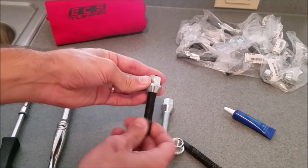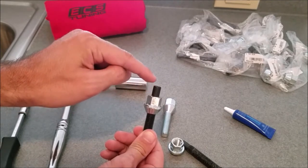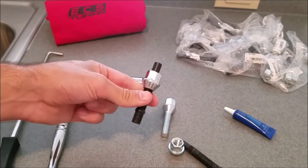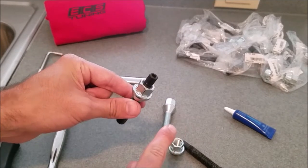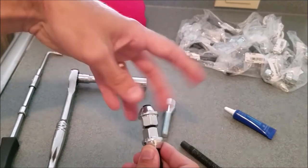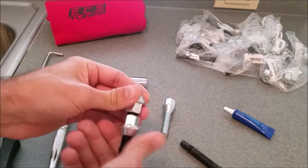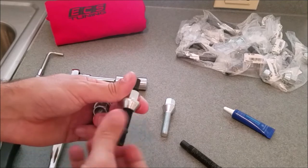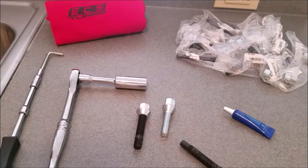The biggest drawback for me is the appearance. The threads are going to go all the way to the top of the nut, but there's this little extra area sticking out the top because it has our hex key so that we can tighten these down. While it looks really sporty on something like a Porsche, on the Mini I think it looks a little silly and it's not quite the aesthetic I'm going for. I might get these torqued down and then cut the head off — because if I have to take them back off, I can do two nuts on here, tighten them together, and then back off the bottom nut. So while it's not as easy and it's going to be more difficult to get a proper torque, once they're installed it shouldn't be an issue and I don't expect to ever take them back off.